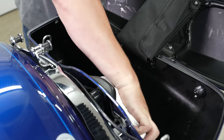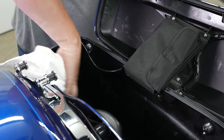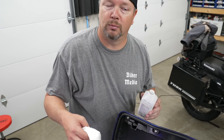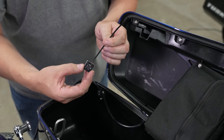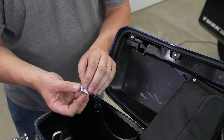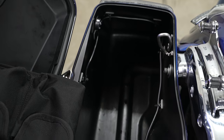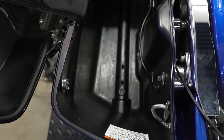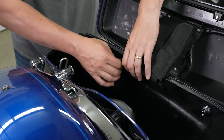He's cleaning the inside of the bag with a little rubbing alcohol. The reason is we're going to be putting some sticky pads to route this wiring around the inside, and this ensures they adhere properly. These little sticky pads come in your kit — you can run a zip tie through them after you stick them inside your bag to secure your wire. Peel off the sticky backs and place them wherever you want inside. You're going to work this wire all the way around to the inside because we're going to drill another hole on the inside front of the saddlebag to bring the wire back out.